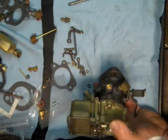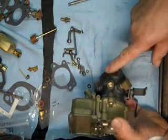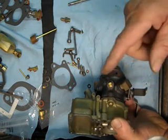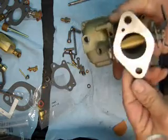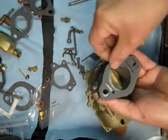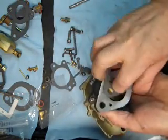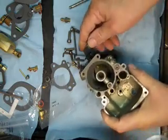On a 228 like this one, clockwise rotation of the idle mixture screw causes a leaner mixture. On a 28, where the idle mixture screw is on the float top, a clockwise rotation gives it a richer mixture — not that that matters too much; I just turn one way or the other to get a better idle. We have machined the bottom so it's nice and flat. The kit comes with two base gaskets of two different types — this bigger one has a slot for the vacuum hole, and you'll want to cover that up only when you need it.